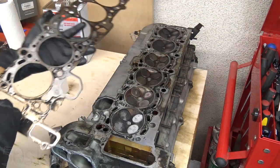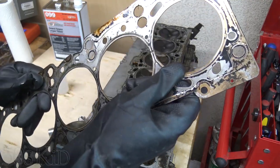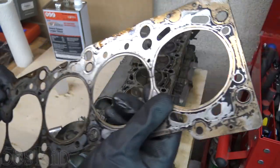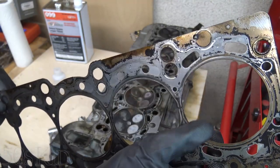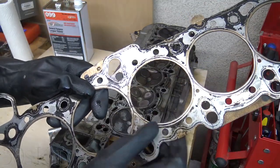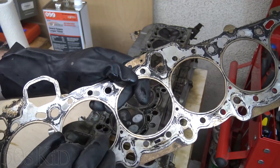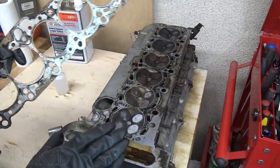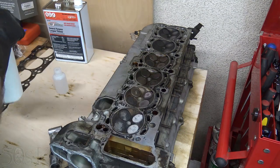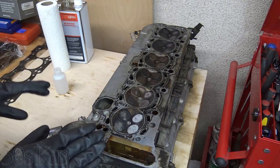Now this is the head gasket — we're going to set that aside. I'm not noticing much; there's a little bit of failure there. You can see a little path through, which actually feels more like physical damage, which is really surprising to me. And right here there's damage too. So I think more or less this is looking like a gasket failure, more than a warped head and overheat situation, because I would have expected in an overheat situation that the threads would have been pulled. So this is kind of looking better and better.